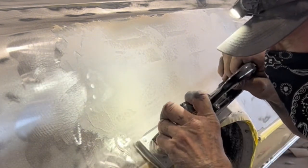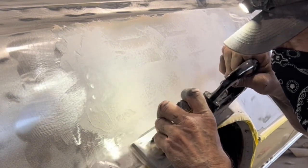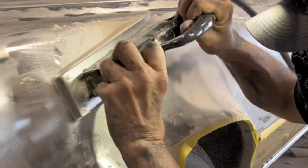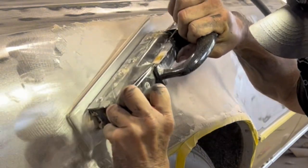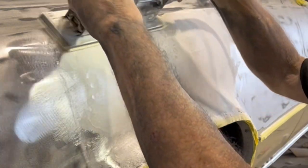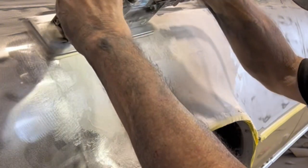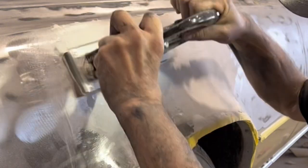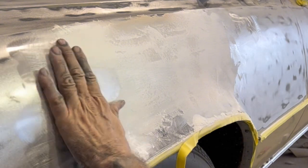And this being so difficult to sand, it doesn't go down very quick, so you don't have to worry about, you know, ruining it real quick, because you're not even going to sand it very quick. It's going to take a whole lot of sanding to work it down. And this fiberglass filler is a rough-in filler. I'm not trying to establish absolute straightness or smoothness or pinhole free or any of that stuff. It's going to have pinholes and divots and all that in it.